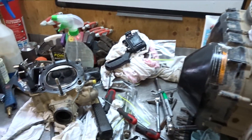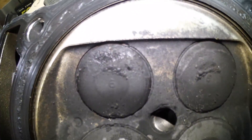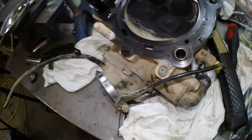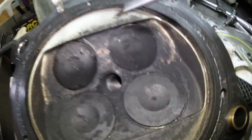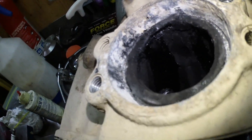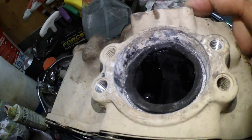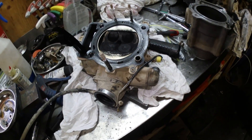It's never a dull moment around here. Now that we got the head off, let's have a closer look at it. That head's looking like ass — same with that cylinder. I don't think I'm going to be using this head. Look at the layers of carbon on those valves — that is super caked on there. And if you look in the exhaust port right there, it looks like it's been pissing oil. I think that's what the issue was — why it was burning so much oil. We're going to use the other head from the other engine.